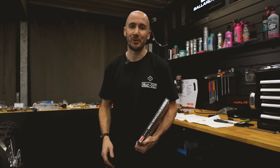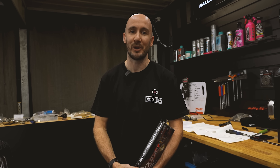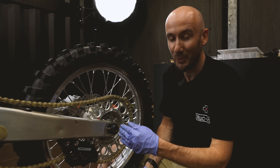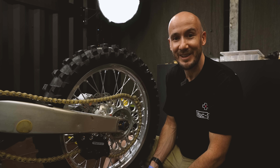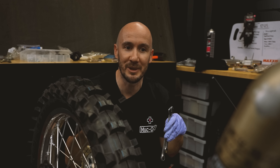We've got the rear wheel in the bike. The original chain was a big O-ring chain and it was riveted on — worst case scenario. We're going with a nice lightweight race chain: it's thin, it's got no drag and it'll allow us to get maximum horsepower through the small 125cc motor. We had a quick chat with Slater — he's going to be riding the bike initially — about where he wants the wheel located in the swing arm. Having the wheel right up the front of the swing arm decreases the wheelbase of the bike, giving a steeper head angle — it'll turn better but be a little twitchy at higher speeds. At the back it's better at higher speeds but won't turn as well. He's opted for right in the middle.